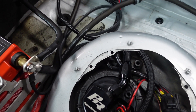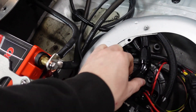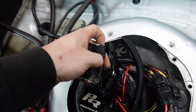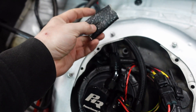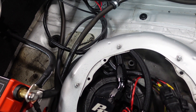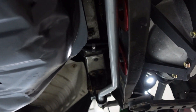I'm probably going to take this back out, drain the fuel, check the pumps, but I want to at least bolt it up, tighten it down, confirm the exact length. I also put this big piece of fire hose coating right here just because I was worried about that edge rubbing on the line. It doesn't look the prettiest but at least it protects the line — you don't want a fuel fire. So let's get it back and start routing.